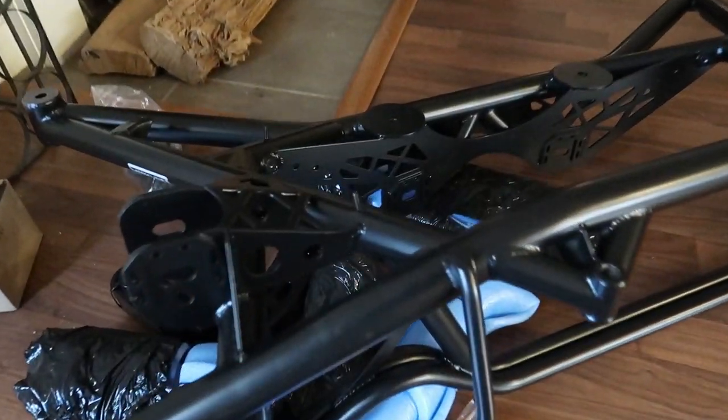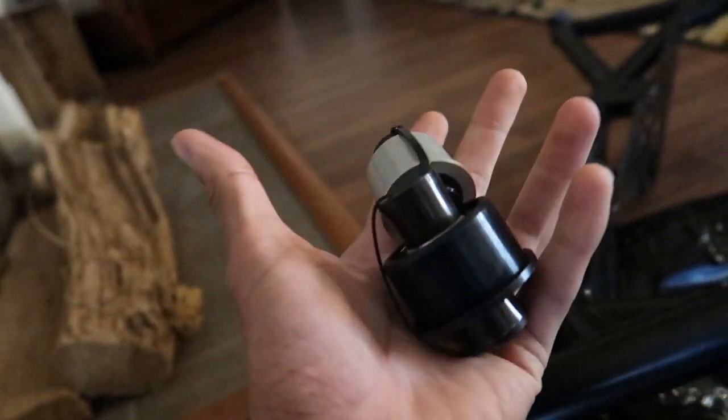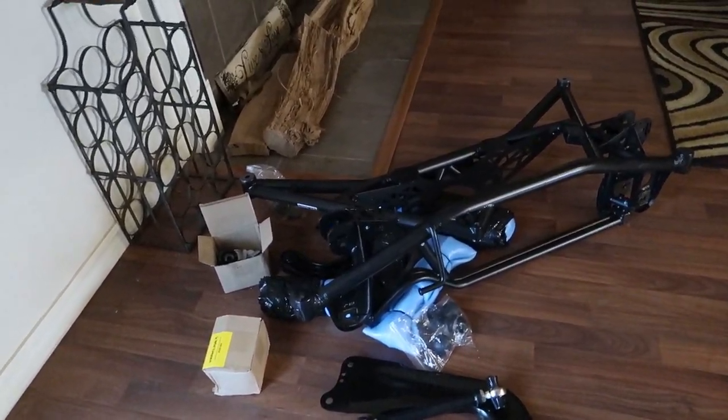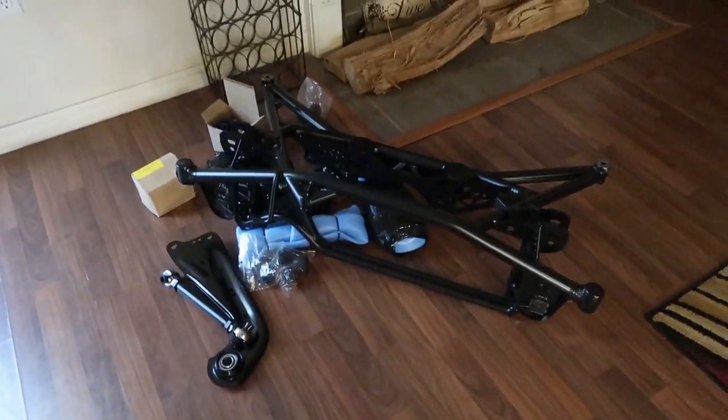What is up guys, it's a couple days early. I still don't have the hardware or the bushings for the differential that I need yet, but I'm too excited — I want to start wrenching. I'm going to drag all this stuff outside. I'm gonna put some stuff on today, but I had to go take things to the auto hobby shop on base tomorrow to press these bushings in. Tomorrow I'll be able to do a full mock assembly with the old hardware, start switching out the hardware, slap the bushings in the differential and get it lined up. I'm gonna have to take the axles off for sure — we'll see, it's gonna be fun.